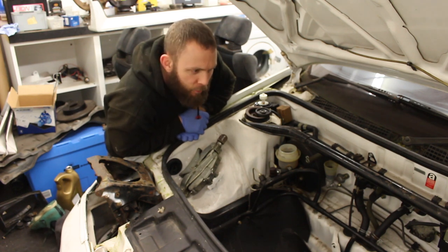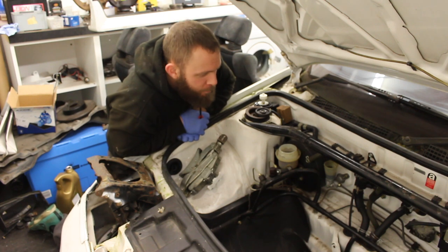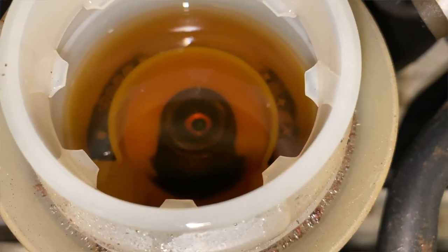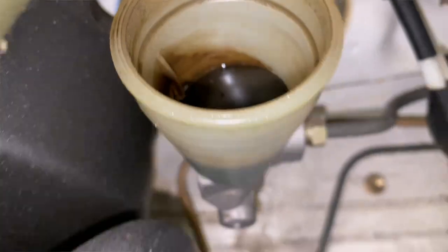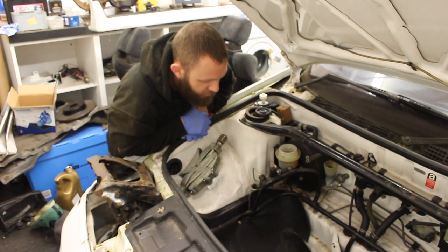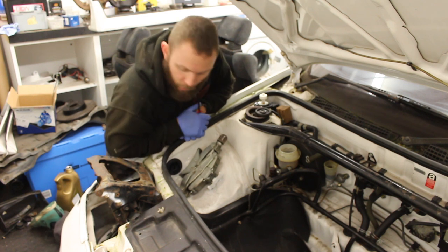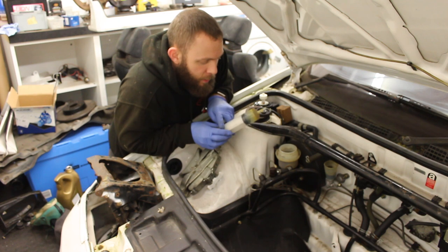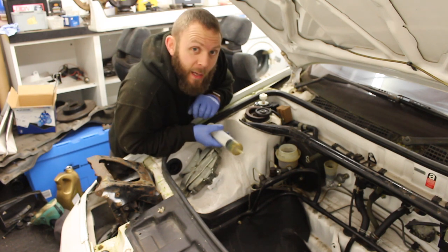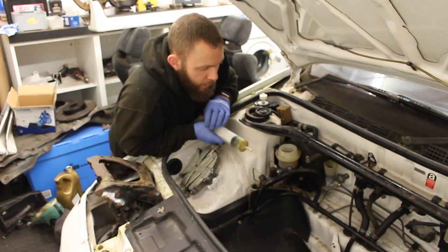We've removed the plastic trim in the front boot — is it a frunk? — and now we can get the lids off and have a look inside. It doesn't look the worst in the world. The clutch is a little bit low and the brake is also a little bit low. There's also evidence of the brake lines being replaced — I think it had an MOT back in the day with a corroded front brake line. So we're going to use a turkey baster or large syringe to suck out all the remaining old nasty fluid, then replace it up to the maximum level with good fluid, so we're starting in a good place.